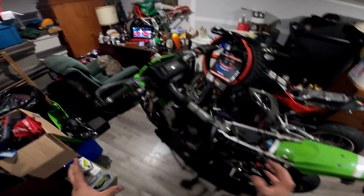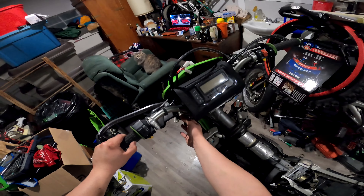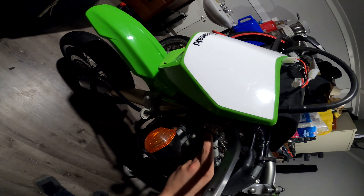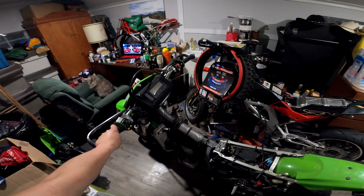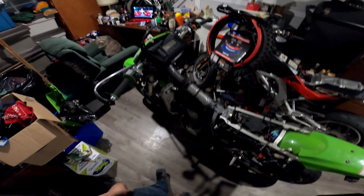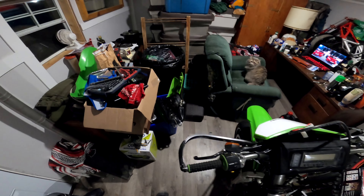We've had a bit of an accident. I got the skid plate on and I've been trying to wire in these heated grips — Oxford heated grips. I mounted the controller to where the triple tree bolts together. However, I was having an issue getting underneath the gas tank, so I was fiddling with the gas tank and the fuel line breaks right in half. That's probably the original fuel line — it spews fuel out all over my garage.